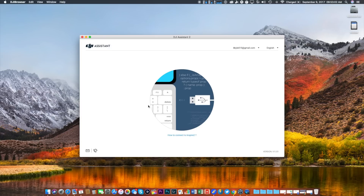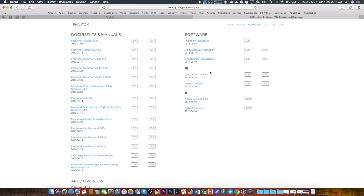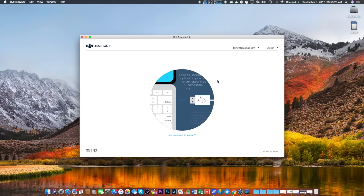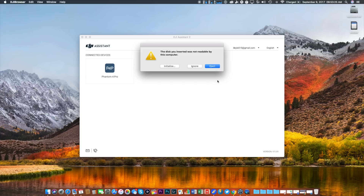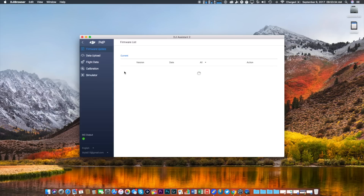Now if you are still having trouble, there is one more thing you can try that will likely solve most minor problems or bugs. This requires the DJI Assistant 2 application for your computer, which can be found on DJI's website — I'll leave a link in the description. Once you've installed the software, open the application and plug in your drone via a micro USB cable. Wait a second or two and it will appear in the menu. Select your connected drone, look for the firmware refresh button, tap that and let your drone do its thing. Make sure you have a full battery on your drone and your computer if you're using a laptop before you do this.